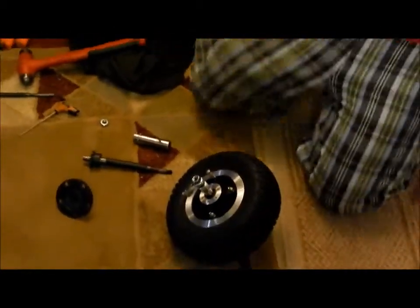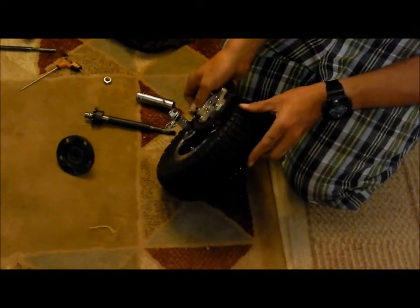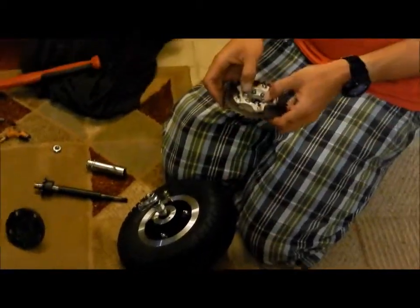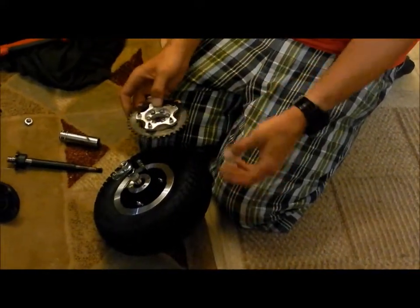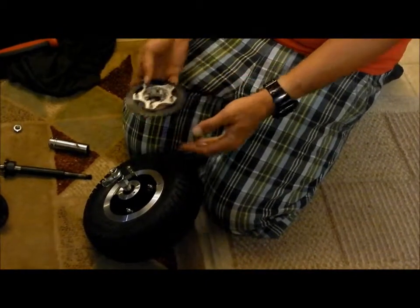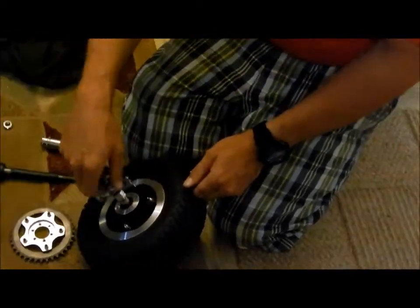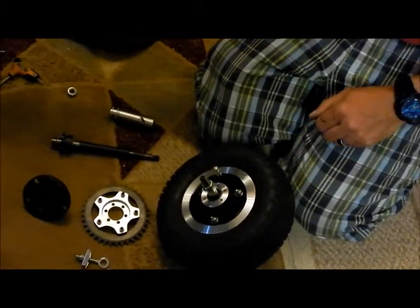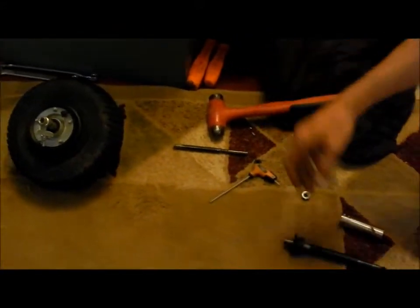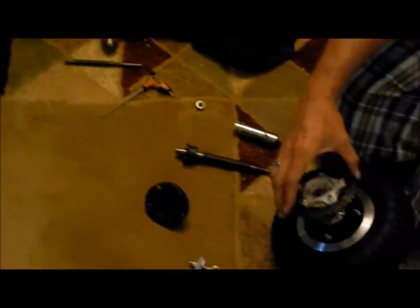On this type of wheel, taking the wheel apart can be rather tricky, so we don't recommend using Loctite on these bolts — just get them good and tight in case you need to take them apart to change tires or fix flats. If this never had to come off again, we would Loctite it, but it does have to come off for flat tire service. There are other videos where we show disassembly of the whole rear wheel — there's a Cobra Gas Scooter rear wheel disassembly video if you want to watch that start to finish.